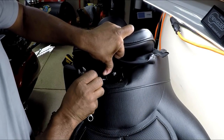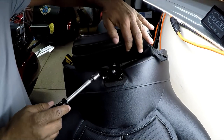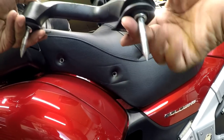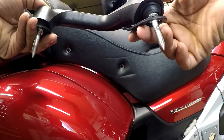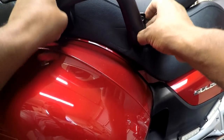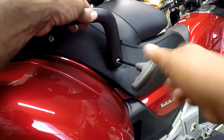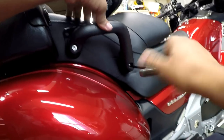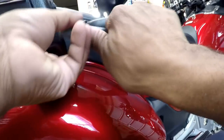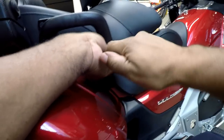Now I can add the hardware. If you notice that these screws are pointed — the OEM screws are flat and they're hard to find the threads — but when you switch to these pointed screws, they go in easy. You can pick them up at Wingstuff; I'll put the product link down in the description below if any of you guys are interested in adding the bungee assist kit to your Honda Goldwing. You almost need two people to put the back seat on to get it tightened back down, but I love these pointed screws and the bungee assist. That way you can strap down items to your back seat and it's a one-man operation.